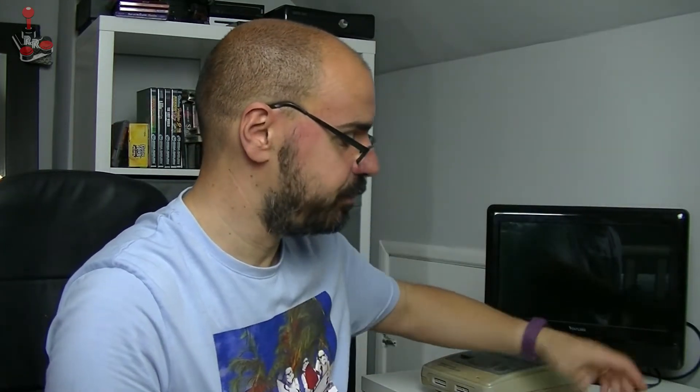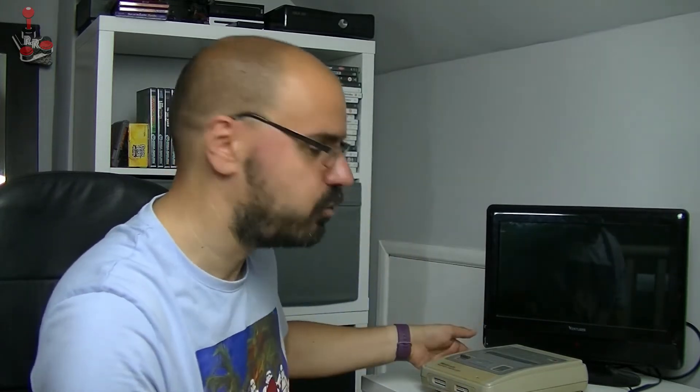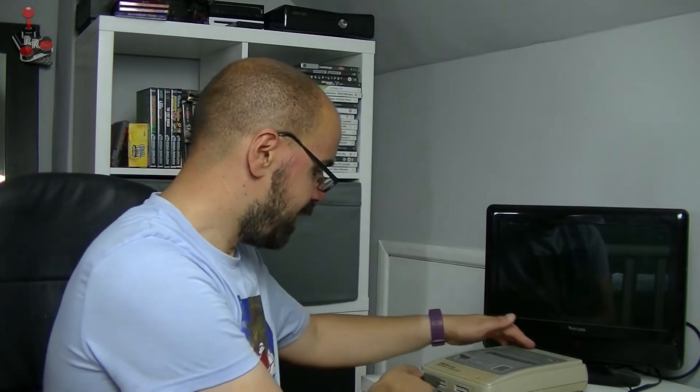For the purposes of the test I've got a cheap Super Nintendo AV composite cable. Now these will output RGB — you can get RGB cables, but I believe the NTSC Famicoms and NTSC Super Nintendo use a different cable to the PAL for RGB. So be careful if you're buying one for your machine. Make sure you get the right one because apparently it can cause damage, or at least it won't give you a decent picture. So be careful. Right, let's get this hooked up.